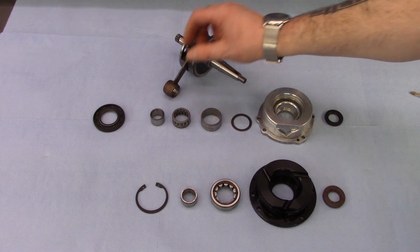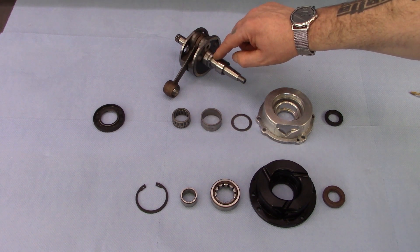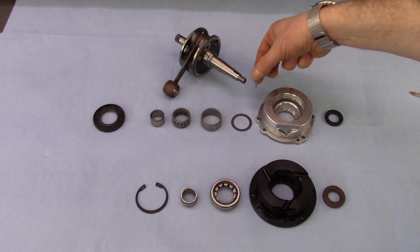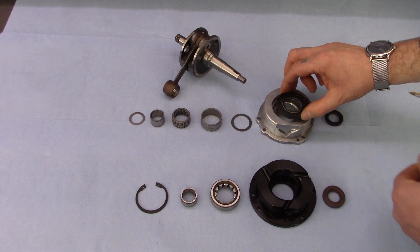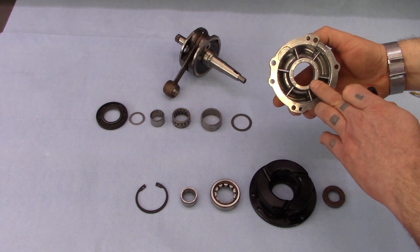This design is primarily to aid eventual removal of the track, which would normally go all the way down onto there. This bearing is lubricated by grease because it is closed within by a large oil seal on the inside and a smaller single lip oil seal on the outer side.